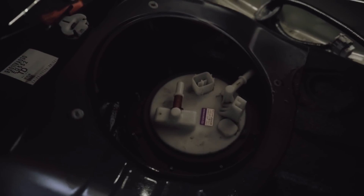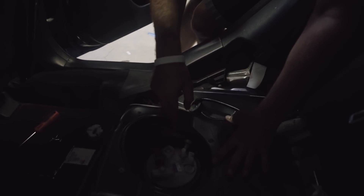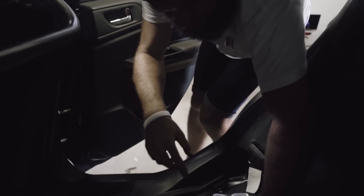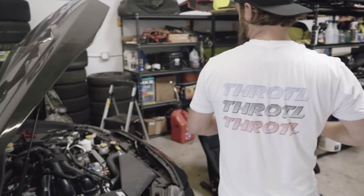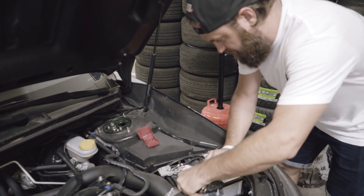Fuel pump is in. Make sure the green clips are hooked back up. We've got red to red so we know we're in the right hoses. Check to make sure they're tight and we're good. Time to put the cover back on — fuel pump's done and in. We are complete. Now we just have to reassemble the cover and the seat and the fuel pump is in. Rear seat pads back in. Time to put the battery back on — 10mm — tighten this guy down.